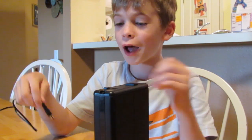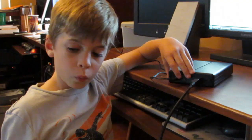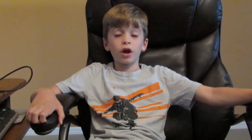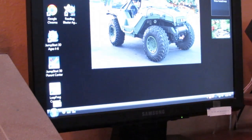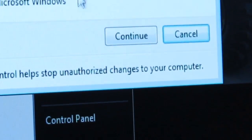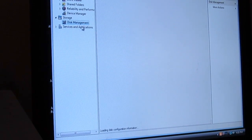Next we have to plug in the power supply, the USB, and then go format it. Once you plug in your power supply make sure to turn it on because when you get it it's going to be off. I have Windows Vista but formatting a hard drive is the same on Windows 7. Go down to the Start button, click on it, go over to Computer, right click, and click on Manage. Click Continue, then click on Disk Management. I tried plugging the USB 3.0 into the back of my computer but for some reason it doesn't work, so we're going to try putting it in the front of my computer in a USB 2.0 slot.